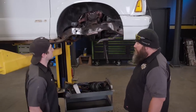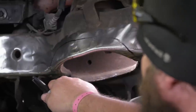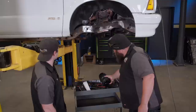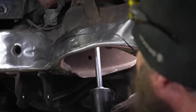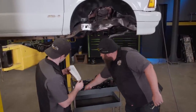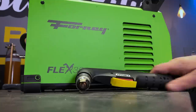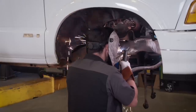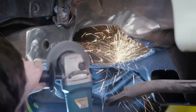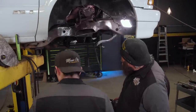We've got our control arms done. While you were busy, I cleaned up the frame and marked it for clearance cuts, because when the air spring is in there, we don't want anything to puncture it or rub on it. And because the air spring is now in the way, we can't mount our shock in its original location, so we're going to hang it on this side of the frame. I started with a template and fabbed up some brackets. That'll save a little bit of work — now I've just got to do the cutting. It's a little tricky cutting in these tight spots, but we'll come back and clean it all up. Plenty of clearance — I don't think you'll have any issues on the road.